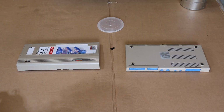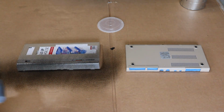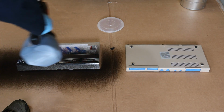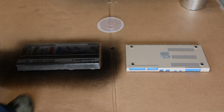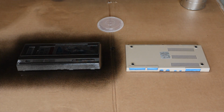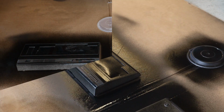To get proper peelability, it's absolutely critical to lay down enough product. I'm going to do 6 base coats and follow it up with 4 top coats. The biggest mistake first-time dippers make is not putting down enough base, even if the coverage looks good. If it's not thick enough, it won't peel off properly, which will leave you with a big mess to deal with later on.